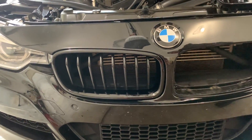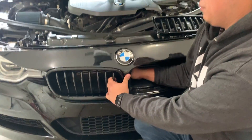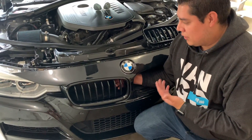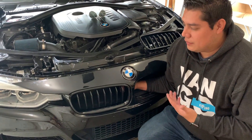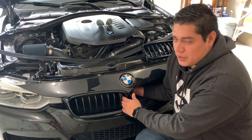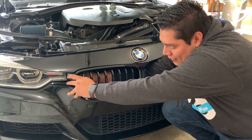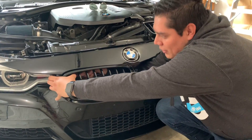It is not an easy process. The best part is once you get one tab out, you can stick your hand behind there and get the others. Just based on that: be careful not to flex your bumper too much — it's pretty strong but you don't want to cause damage. Also be careful with the tabs: they're made out of plastic, and since they're near the engine bay the plastic will be extra brittle. But like Dallas said, once you have one out you can pretty much get to the rest — and we did not have to break out a saw for this one, so the second grill will be a lot easier.